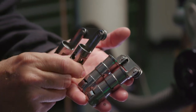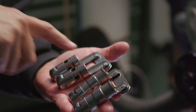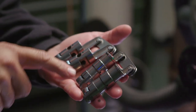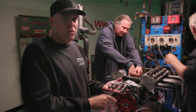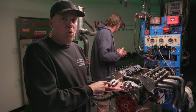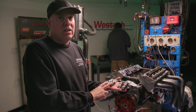The solid lifter, as a result of not having all that stuff, can often be designed shorter, and that means they usually need a longer pushrod. So adding up the weight of the lifters themselves and also compensating for the difference in pushrod length, we're saving 49.88 grams per pair of lifters by going to the solid.